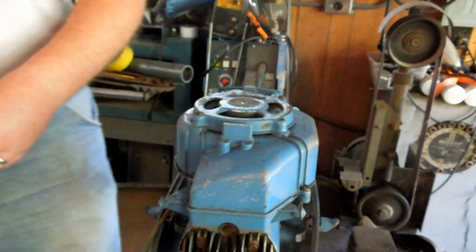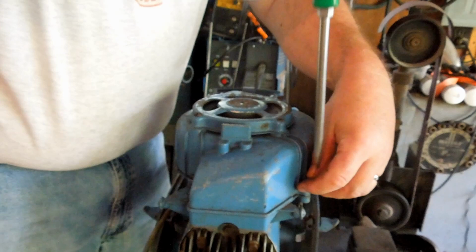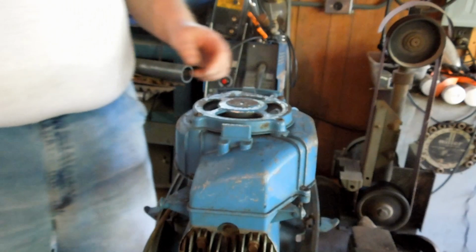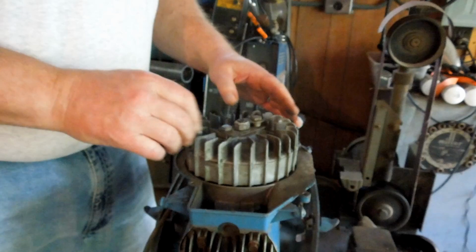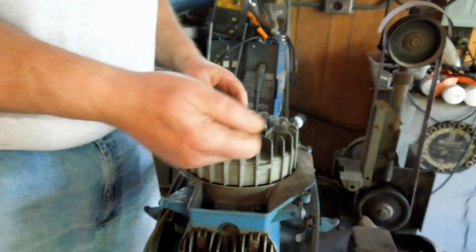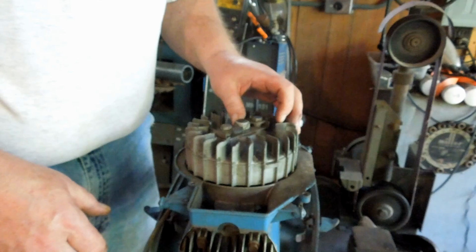I had a Johnson 10 horse outboard. And I was out on the lake with it with a couple of friends. We were out fishing and it wouldn't start. So I pulled the cover off and found that the float bowl had fallen loose. Well, I didn't have any tools with me. So I disassembled and reassembled the carburetor mount with a nickel. Yep, the nickel just happened to fit into the slot on the screws. And fortunately, it was held together with slot head screws. So I was able to take it apart.